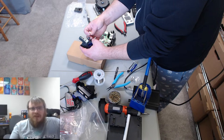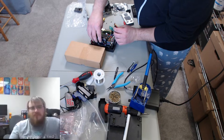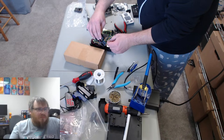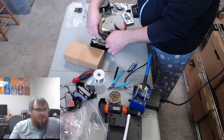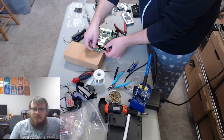Don't plug it in there, because you're going to plug it into the Blue Retro board. Oh, okay. So now I basically just slide this into place. And I did end up using too much slack, huh? But, you know, you win some, you lose some. The one thing that I didn't do, which I'm just going to redo real quick, is these should be pointing to the inside, not to the outside.